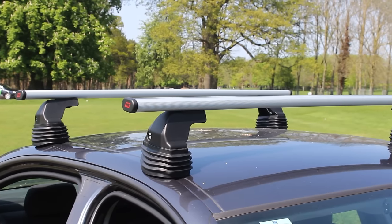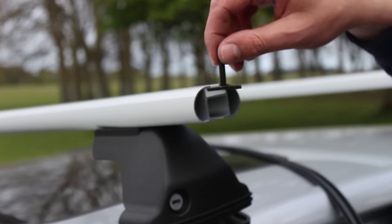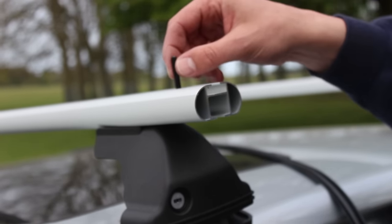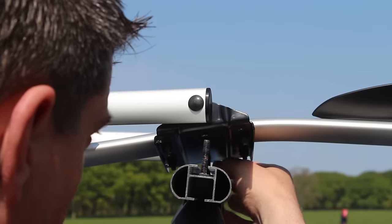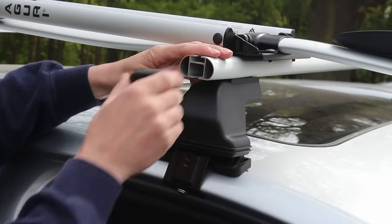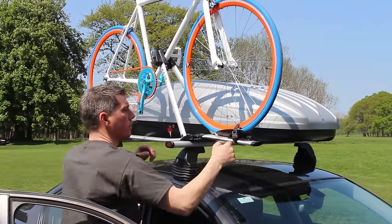The Pacific Aluminium roof bars have a lovely satin anodised finish and also measure 30mm in height by 53mm in width. Where the aluminium bars differ from the steel ones is that they have the added benefit of the T-Track system, which is a universal mounting system common to pretty much all aluminium roof bars, enabling you to fit a certain range of accessories in a slightly neater way using the T-shaped mounting bolts.